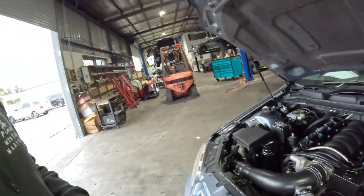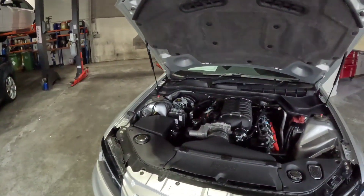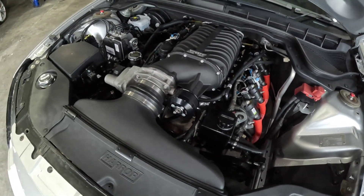It's absolutely worth it in the end. The big thing with turbochargers is you can just keep winding power in, and with a big enough turbo this thing can just keep feeding and feeding. You can just keep ramping power in. With the supercharger, you kind of set your boost with your pulley and pretty much get what you get — you have some fine tuning with pulley speeds but you've got certain restraints. With the turbocharger there's a lot more fine tuning available. I am a turbo guy at heart — all my cars are turbocharged.